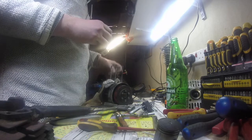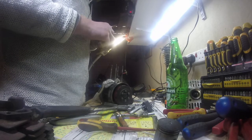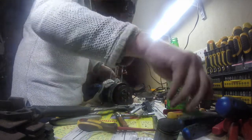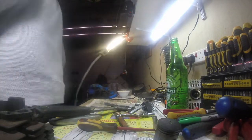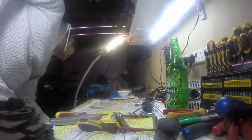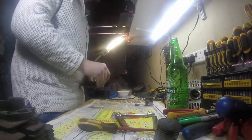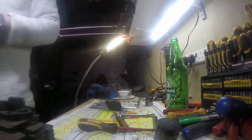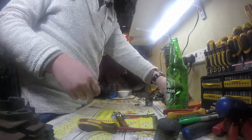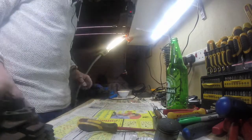I've got the ring tool here but we'll take these off the old fashioned way with just your fingers. The way you test the ring gaps on these — I'll have to look it up in the book in a minute. The barrel that's been marked up for porting — that can go out of the way, it's going to be done tomorrow. Everything in its place — head is fine as it is, that's going to go back with the ported barrel.